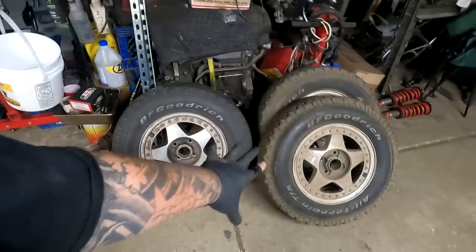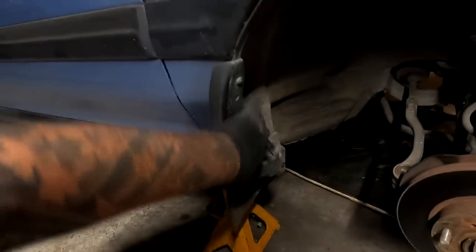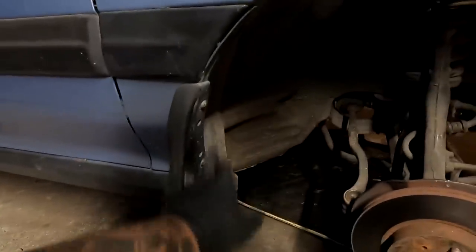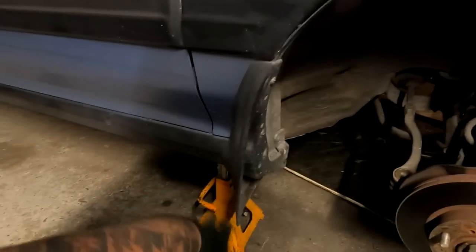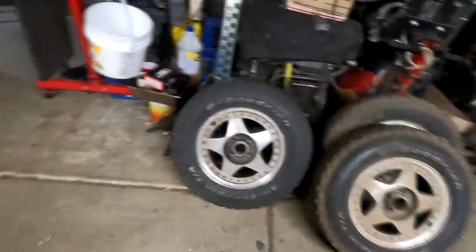You can see the dust on it is pretty thick. This size wheel and tire combo is not going to require me to modify his side skirt and fender lining. On the brown car with my wheels, I had to cut the side skirt and fold in a lot of the tabs so he could do a full-lock U-turn, but I'm trying to avoid all of that. These are going to do the job. Everything is done on the left and right side on the front half of the car, and I already figured out which ones are fronts and which ones are rears. Let's get to mounting.